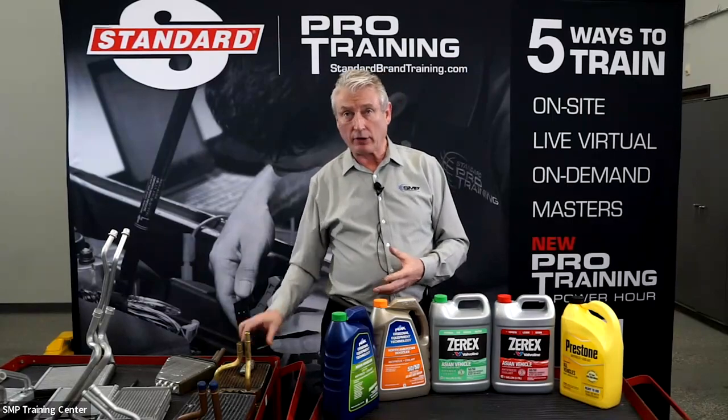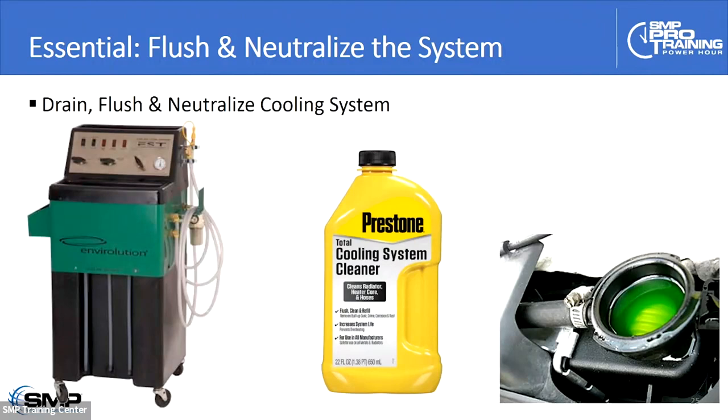In summary: if the coolant chemical condition is poor and you've identified an electrolysis issue, you do not want to just replace the heater core and refill the system with coolant. You need to remove the thermostat and thoroughly flush the cooling system first. It's not just a question of draining the old coolant and refilling with fresh — you need to drain, thoroughly flush, use a neutralizing product, run the vehicle for about 30 minutes with the neutralizing chemical installed, then drain, flush again, and add fresh coolant to eliminate the underlying chemical imbalance. Otherwise you will have a repeat heater core failure.